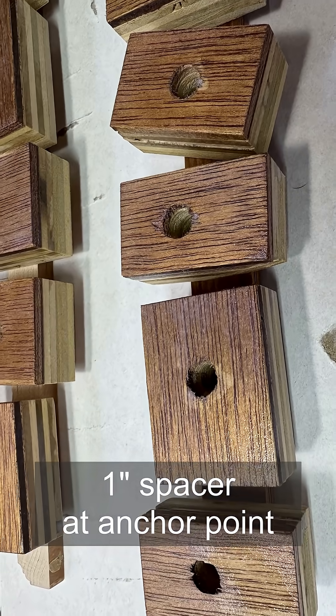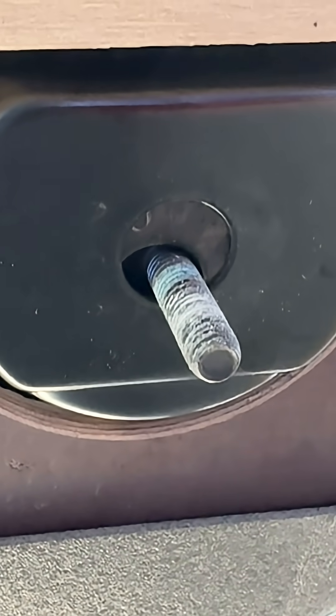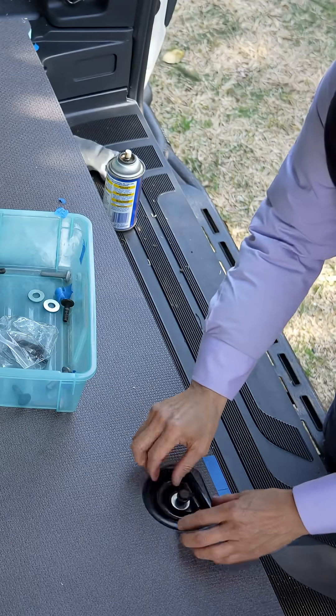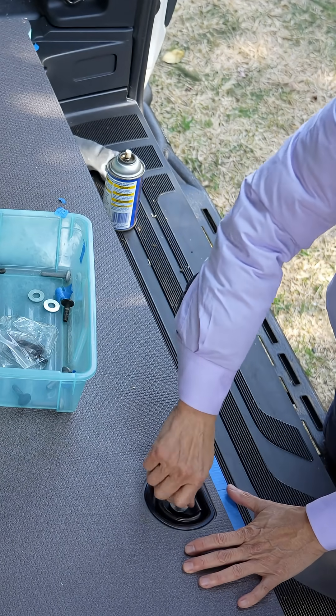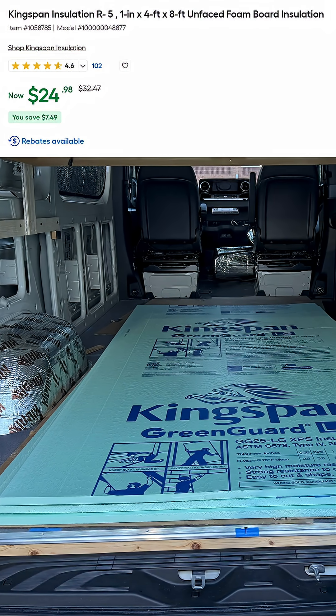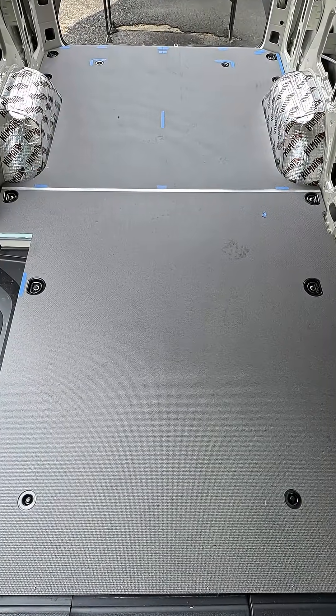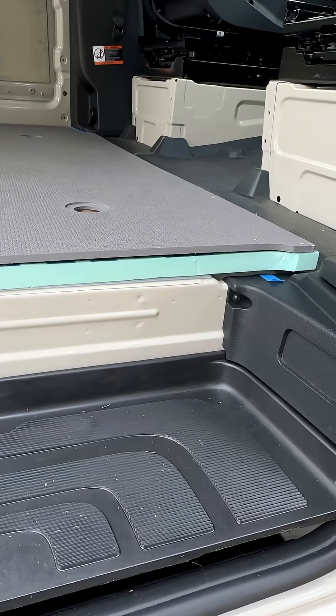Since you are raising the factory floor by one inch, don't forget to use longer, good-grade alloy steel bolts to reach the chassis for floor security. No framing means no thermal bridge. You only need three sheets of XPS foam at around $25 a sheet — you are insulating your entire floor for less than a hundred dollars.